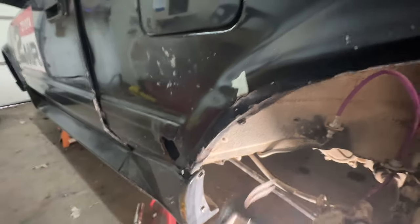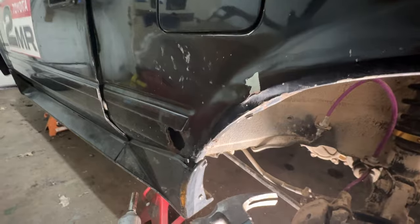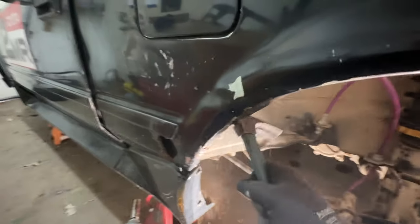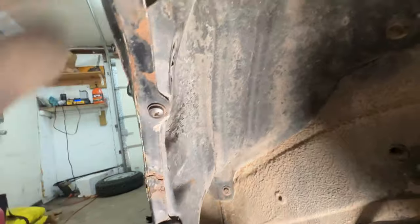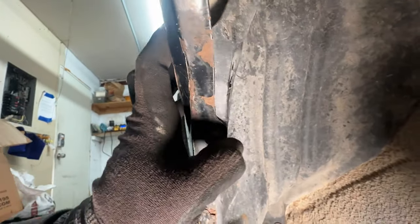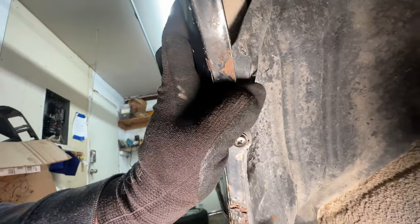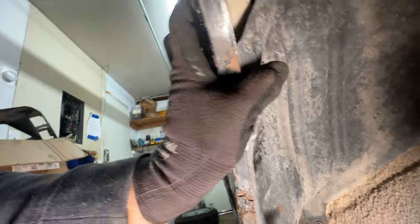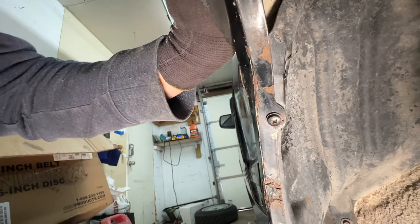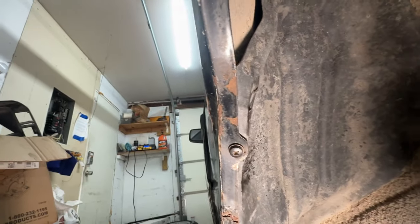This splitting — don't worry about that. That's on the outside of the car. We don't care about the outside of the car. What it looks like out here does not affect how long our tires last. I honestly think that might be enough. Now let's take a look at the previously rubbing area — I think that plastic's pushed in some now. We're not worried about the plastic itself; we're worried about it rubbing and catching on the tires. So maybe we could just cut this out — just one little section there. I'll try to get this off and see if I can bend the inner fender out a little bit.